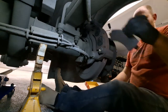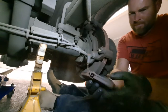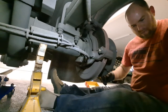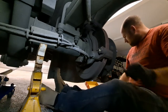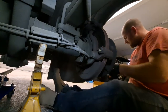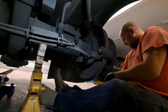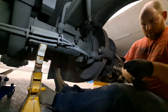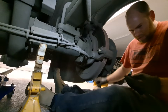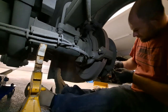Go ahead and pull the brake pads — just get those out of there. You can see this one's got the wear indicator sensor, so I'll leave that one in for reference. Next, because I've got a nice kit here — I did the Rock Auto Bendix kit — it comes with new abutment clips or shims. I recommend doing one at a time. Take the old one off, and match it up to make sure you're doing the correct placement.